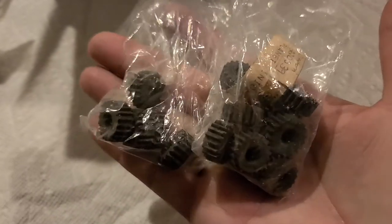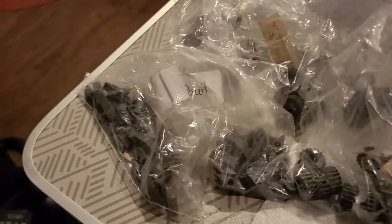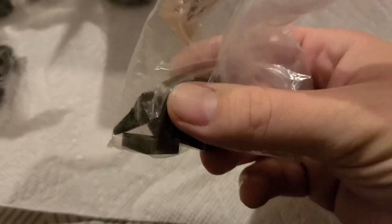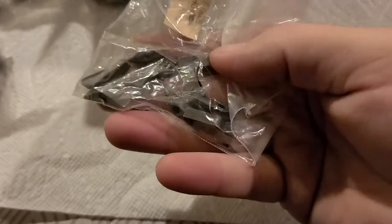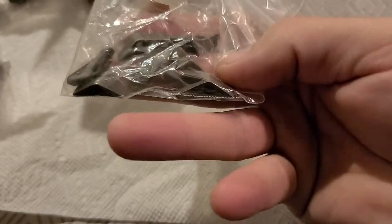Many planetary gears — they all seem to be unused and brand new. These are just lock nuts of all different colors; these are the older style that are 15mm. Now these other pawls — there are so many — are low gear pawls. And these are actually the high gear pawls, where they go on the ring gear; they have a tail on them. The tail is lifted up when the clutch pushes them to make the gear work.